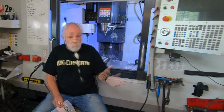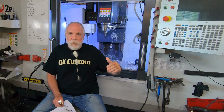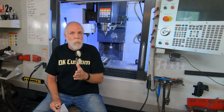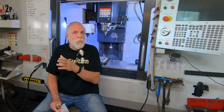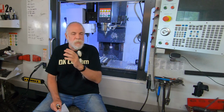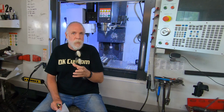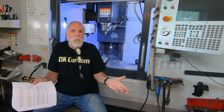We've talked a lot about engine temperature, and we realize a lot of people don't have power visions or FP3s or a way to really read what their engine temperature is. But there's a really simple way to find out what your engine temperature is if you have an oil cooler. If you look at what your oil temperature is after running 45 minutes to an hour at a steady clip, 50 miles an hour or faster, you're going to have a very good idea of what your engine temperature is, because the oil is going to normalize with the metal.